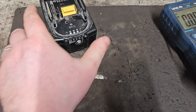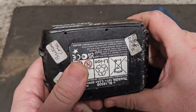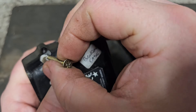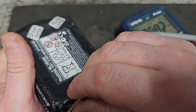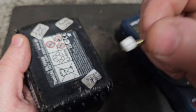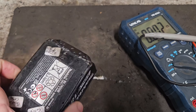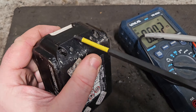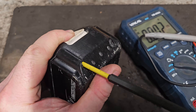So to find out why the faulty one isn't achieving anything near that, we're going to have to open it up. We're focusing on Makita batteries here. There's a white security tab that goes down one of the holes — to remove it, put a wood screw into it and pull it out with a pair of pliers. This is a tamper-proof tab that Makita puts in all their batteries. Underneath you'll see a T10 Torx screw, and we have to remove four of them to get the battery open.